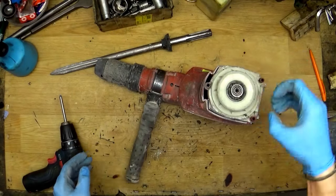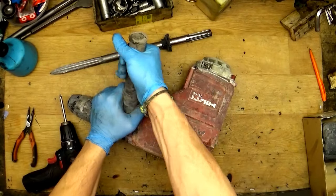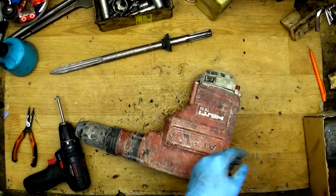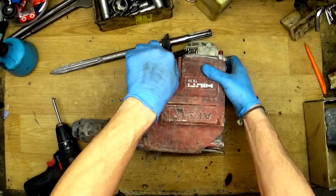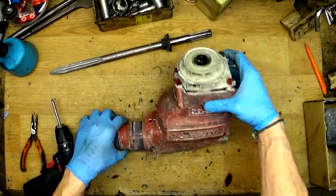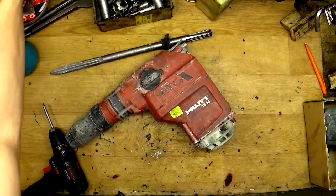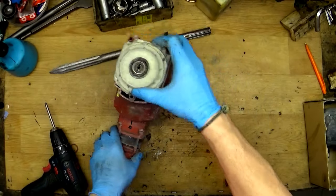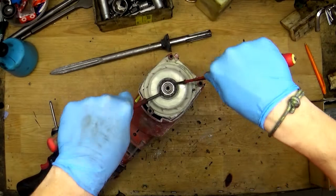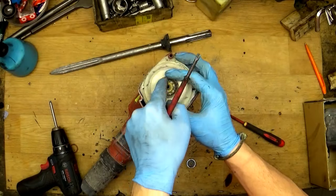We have the one-way. We can remove the ball bearing here and we need to take out the carbon brushes. Removing the carbon brush — it's long, almost like new. Now we need to remove the ball bearing, and the easiest way is to use two screwdrivers. Of course we will damage it a little bit. I think this was touching the housing or something, because we can see that this one is all melted here.